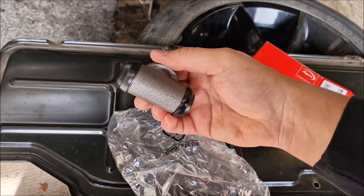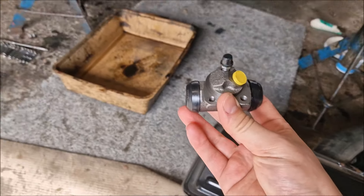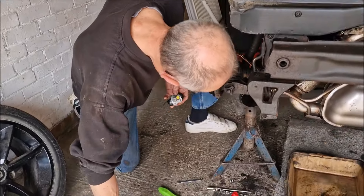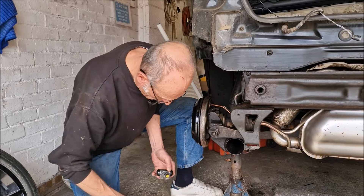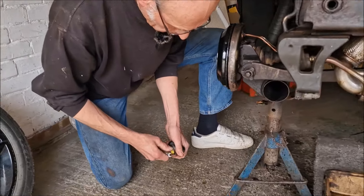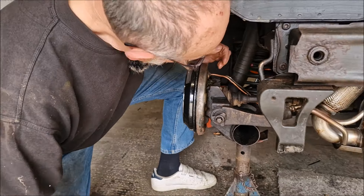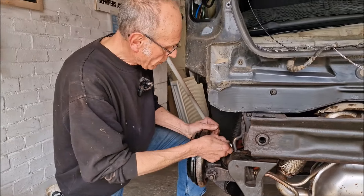It's not a genuine Smart part — it is an aftermarket part, and it does look different to the one on the car. Dad passes it over to check it's the right thing, and it looks all right. We've also fitted new brake pipes previously, which is on the channel. To prepare: clamp the pipe off, crack the union, take out the bleed nipple, and take the fixing screws off. Should be pretty simple.